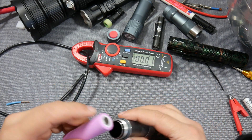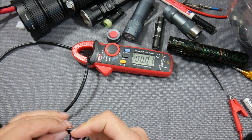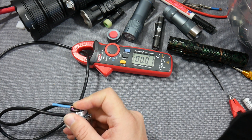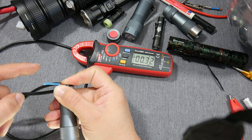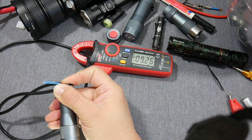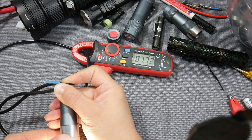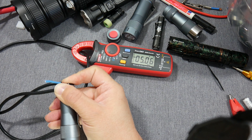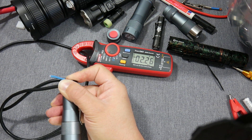Keep in mind the temperature regulation of this flashlight is very good. Let's demonstrate — hopefully I don't take one for the team and burn my hands. When you look at the numbers on turbo: double tap for turbo — it's 9 amps now. And now you can see it's already getting hot because we had turbo on before. It tries to regulate around, now dropping to 5, still heating up, now dropping to 3.5 amps, dropping to 2.5 amps — so the regulation for heat is really good.